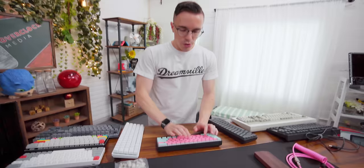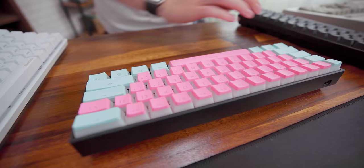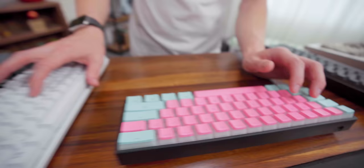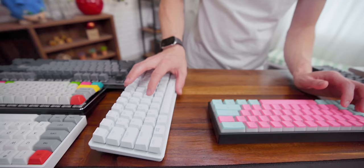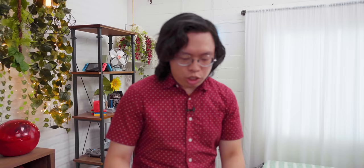If you want to blend the two, you get what is known as a tactile switch. It has a lot of the same advantages of a linear switch, but you have a little bit more of an actual click — you can more feel it than hear it. There's a little bump when you press it. With the clicky switch, you have a much more pronounced click and a lot more sound. Basically it's all about confirmation: do you want audible and physical confirmation, just physical confirmation, or no confirmation at all?